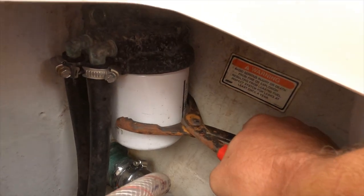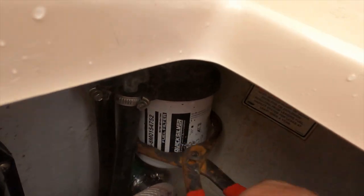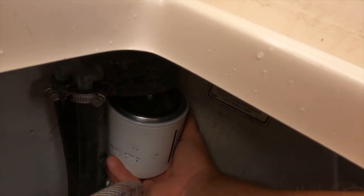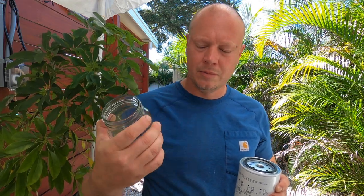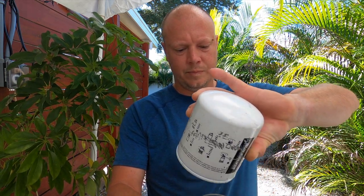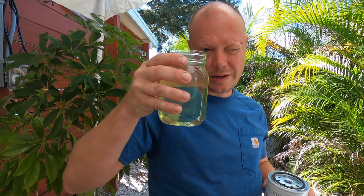We're going to play a fun little game of 'does my wife watch my YouTube channel.' Last bit of maintenance before we put the boat in the water — this is how we check: surprise, mason jars. I'll clean it out, take the fuel filter, and dump everything in here. First glance, that looks pretty good. There's a little bit of sediment floating around. I'm going to let this sit for about an hour, check for any water that separates, and it'll give a good idea what the inside of the fuel tank looks like. Meantime, I'll replace it with a new filter.